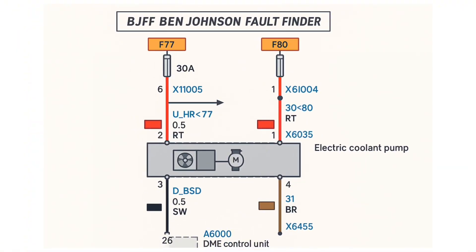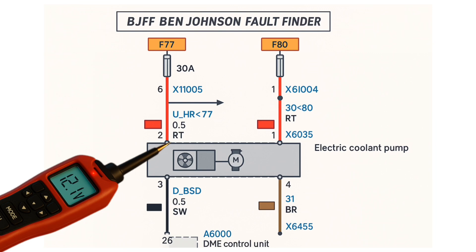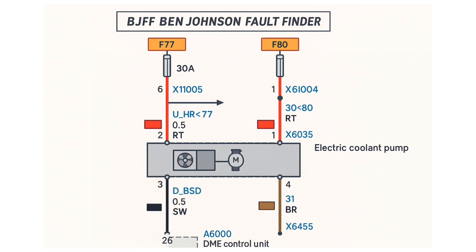Here's a wiring diagram — it's my own diagram, a representation similar to BMW but not BMW, so no copyright issues. Basically you need to check the ground with a power probe or multimeter, then check that you've got the lives you need — a 30-amp and a 5-amp fused supply. Once you've confirmed ground and lives, the next thing to check is whether you have an issue with the BSD — the Bit Serial Data bus — controlled from the DME.